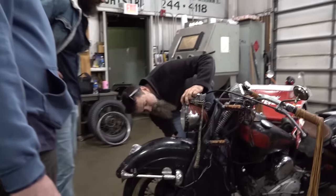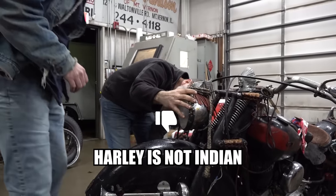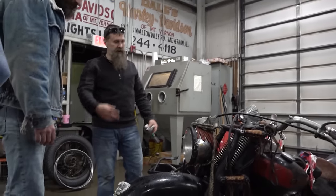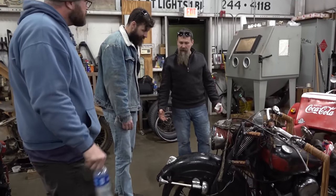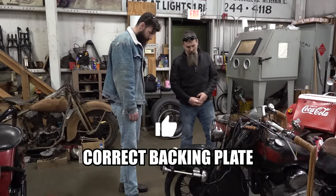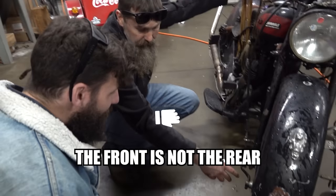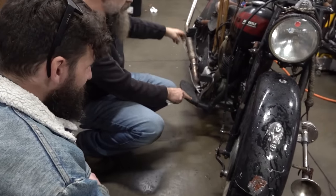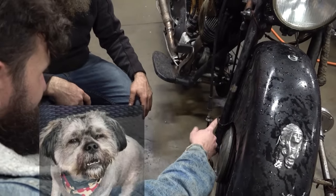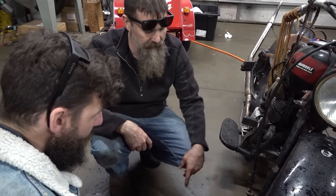Their headlight is kind of the proper type - it says 'Cycle Ray Guide,' so that's actually like a Harley headlight, maybe a remade Harley headlight. It's kind of a personality bike - it's got the flavor of the owner all over it. I think your brakes are right. Your front brake backing plate looks like '48. This is kind of custom here - how they extended that way out - and this is actually a rear brake arm. They extended it because they couldn't find the right brake arm, so they added this bolt just to bring it out, instead of bending it or finding the right one.